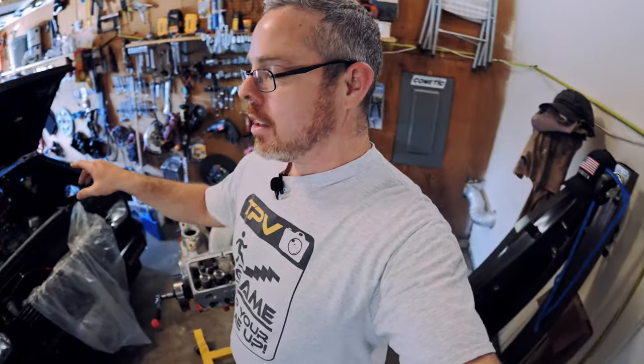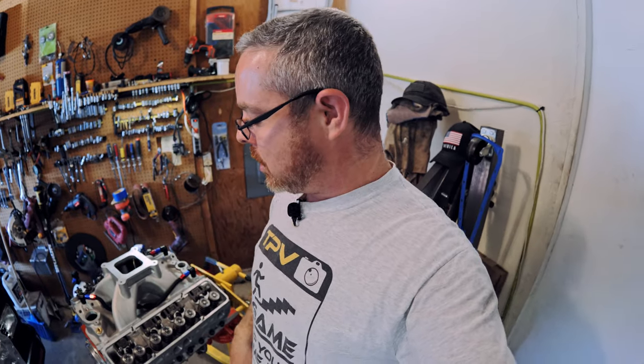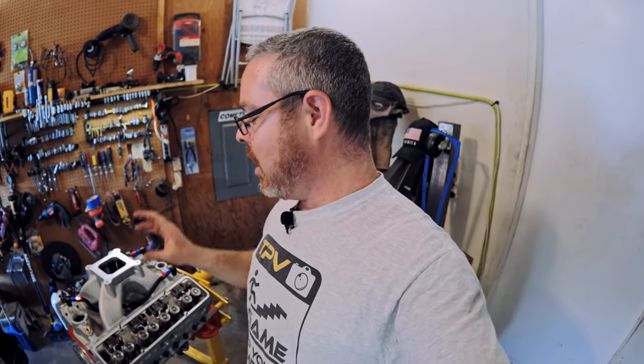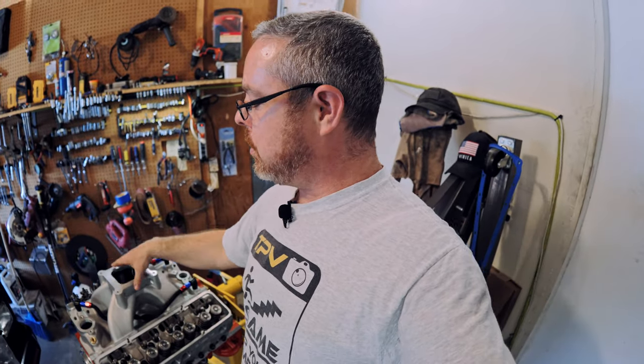That's pretty much the progress on the 400 small block Chevy. I don't want to bolt the intake down yet — I want to get the spacer and the nitrous plate off that other motor first, to make sure nothing's blocking. I'm also not going to put the rockers, push rods, or set the lash and lifters until the intake is on, because it doesn't take long to drop those in. My day job has sped up a little, so updates might be less frequent, but this engine is definitely going in. Subscribe and hit the bell so you know when I make progress — I'm pretty excited to get this thing in. Until next time, keep wrenching!